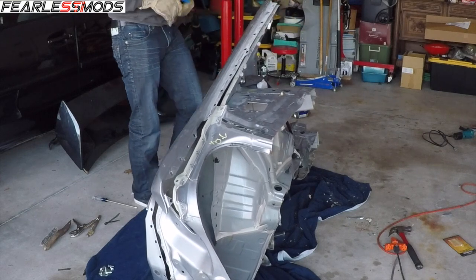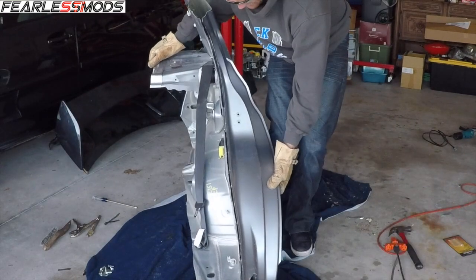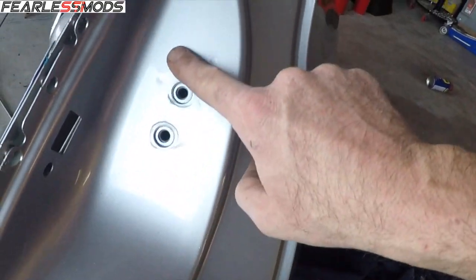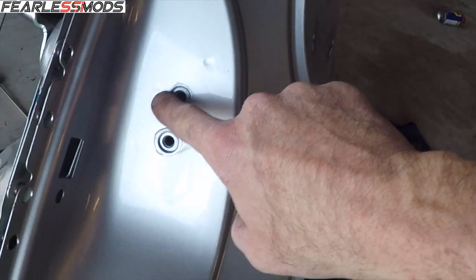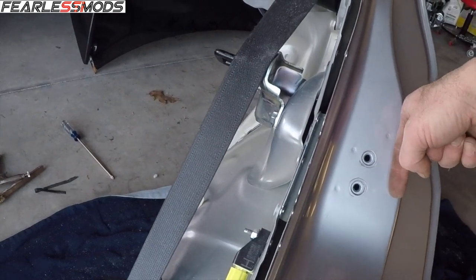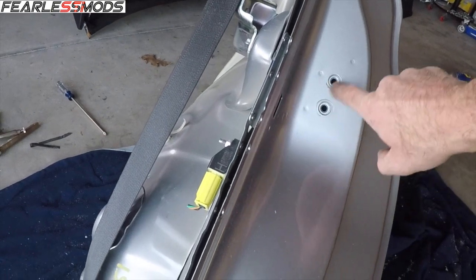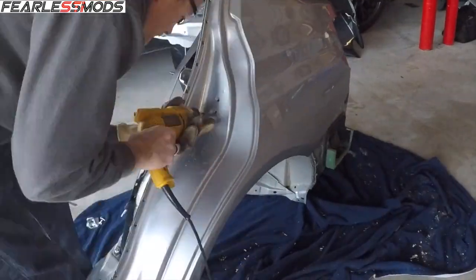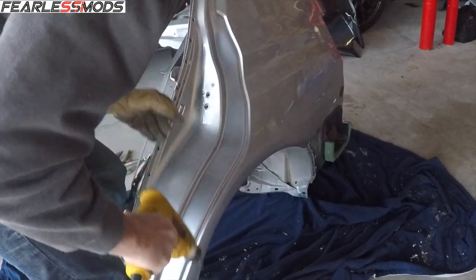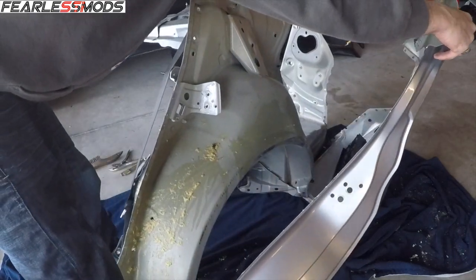I think I see it. I thought I wasn't going to have to worry about that. It seems really ridiculous that these 3 spot welds here would be required for the striker plate. But it looks like that piece of metal comes across, up, and over to here. And so that's what's holding that on. Alright, let's see. Ta-da. That's super simple.